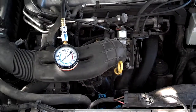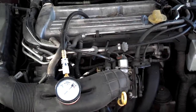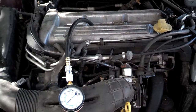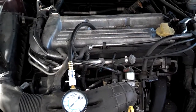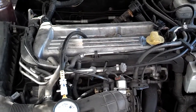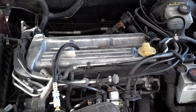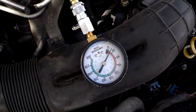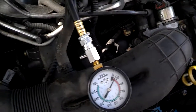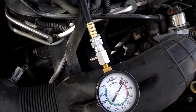It's rough running on a car with a bad cylinder — burnt valve or whatever it is. The only real fix in the short term is to disconnect the fuel injector for that cylinder so it's not getting gas pumped into it and pushing fuel into the exhaust and catalytic converter. She can decide whether to scrap the car or have the motor rebuilt. It got a little better but not a lot, so it may be a piston sleeve slip or burnt valve. The only way to really tell is a leak down test — you bring the piston up, put compressed air on it, and see if it holds pressure or if you can hear air escaping the motor.